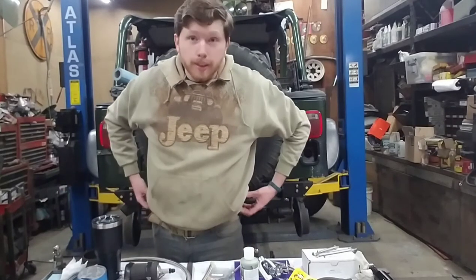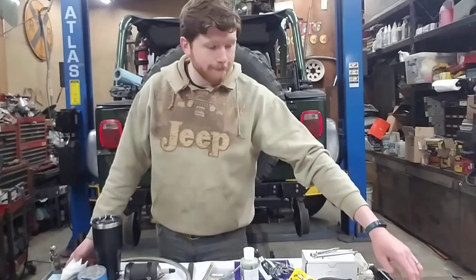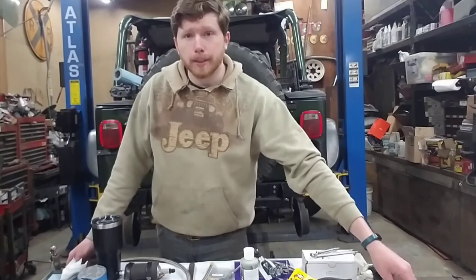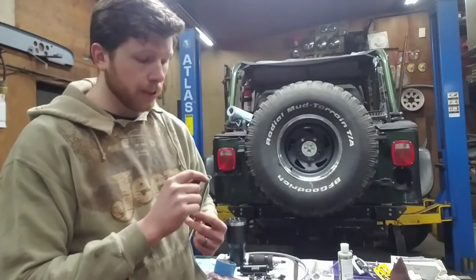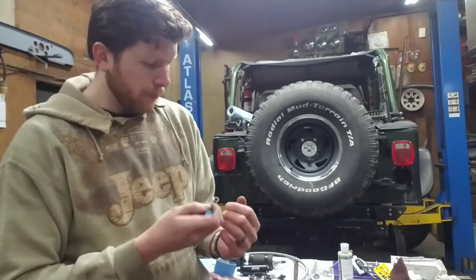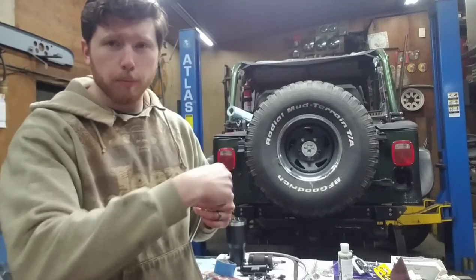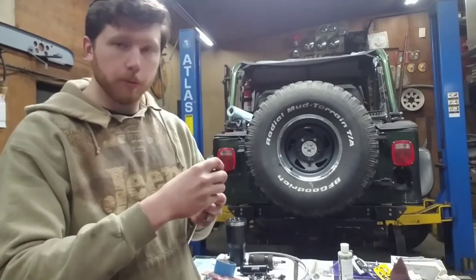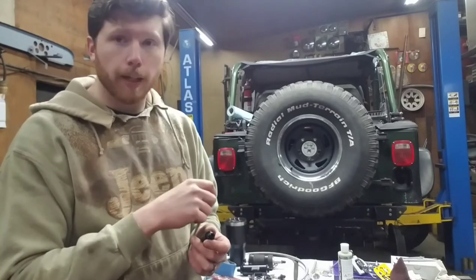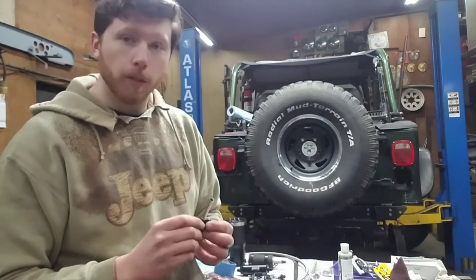As you can see, we have some leaks. It's leaking from the flare side, so I'll pull these apart and see if I can cut some tube and reflare them. I think I found the problem — when I pulled it apart I could see there was a line on the AN fitting and almost like some raised material, not quite a burr, that I think was keeping it from fully sealing on the full face of this angle. I got it cleaned up, filed it down, and hit it with some Scotch-Brite. We'll put it back together and hopefully it'll hold.